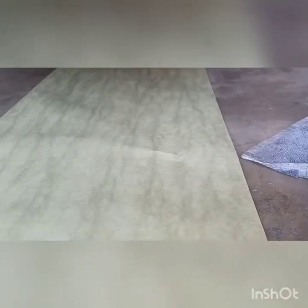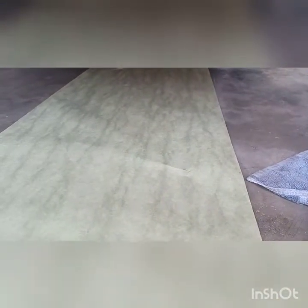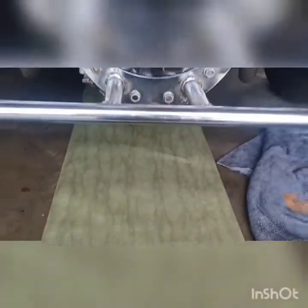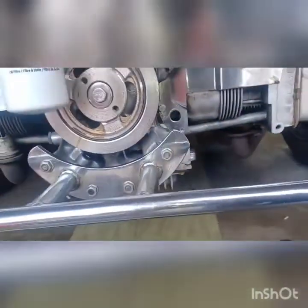It's about 10:49. I just wiped up the little drips from right before, so this is a test of whether it still leaks in a static situation once it cools off — it's still warm actually. This is kind of the summation of the sealing job. After about an hour of just sitting, we've got one little drip. In general, I don't have anything hanging; no oil hanging there. I would summarize this as a good sealing job for a Corvair.